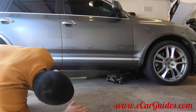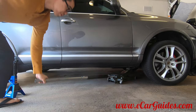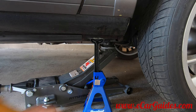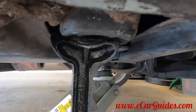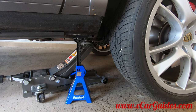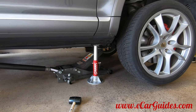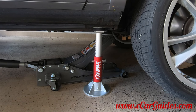And finally, let's move on to the Cayenne and see if these jack stands can also work on a taller vehicle. In order for these jack stands to work, they need to be compatible with the Cayenne's jack point and also provide enough height to keep the wheel off the ground. Starting with the Duralast, it actually works decently well on the Cayenne. Even though the Cayenne has a flat lift point, you can position the Duralast jack stand correctly so that the lift point sits on the edges of the saddle. This will still create some pressure points, and I am worried that this could cause damage to the jack points over time, but it does work for the most part and it passes this test. Height-wise, the Duralast jack stand is more than tall enough to keep the front tire off the ground. Moving on to the Sun-X, the jack stand is the shortest of the bunch, but in the tallest setting it's still able to keep the front wheel off the ground by a couple inches. You can get a little more clearance and protect the jack point by putting a hockey puck. So despite being the shortest jack stand of the bunch, it does work on the Cayenne.